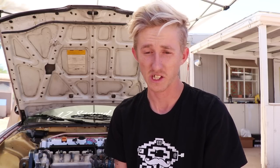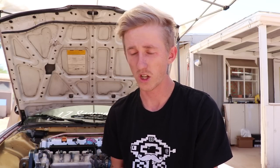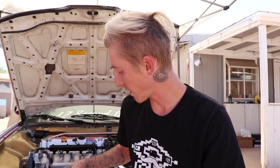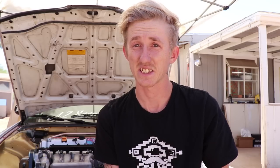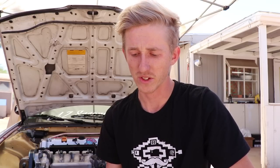A lot of people don't mind the firm pedal feel. A lot of people like it because they feel it's more driver-oriented — you're not as prone to locking up the brakes because you physically have to push the pedal further down yourself. You don't have the quickness of slamming on the brake with the booster making it easy and locking them up super quick. In my Del Sol, which is my daily, I've done that a few times during emergency braking — I don't have ABS and I've locked it up pretty easily. I've only locked up the brakes with the booster delete once, and that was just testing to see if I could.